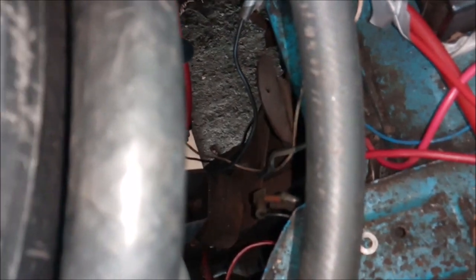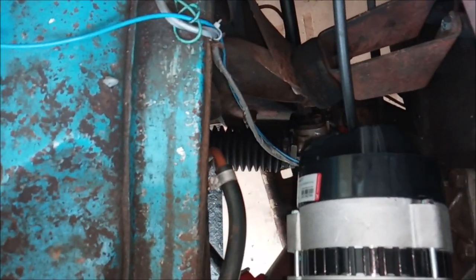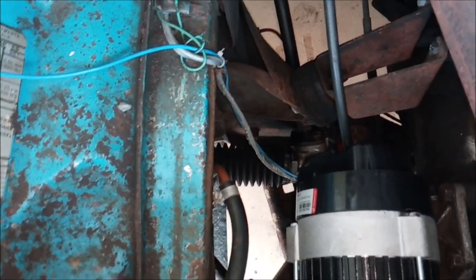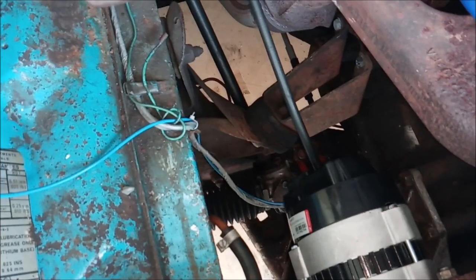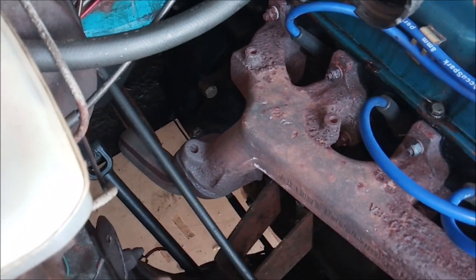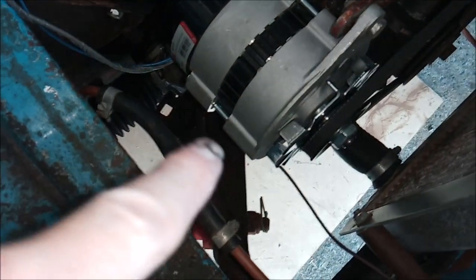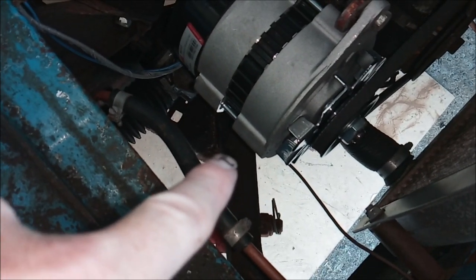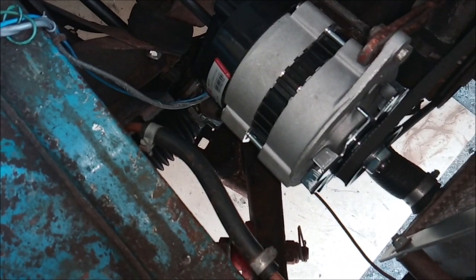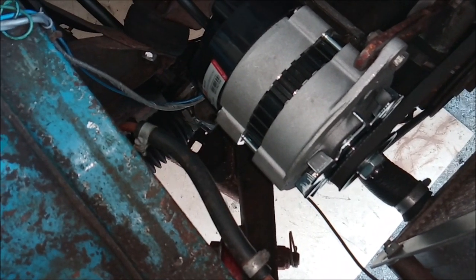So what I'm going to do is unbolt these. What I'll do is I will film unbolting that one, unbolt the other one separately, then I'll jack up the engine from the mount between where it bolts to the gearbox. Because to me, that's kind of like the only place I really can jack it. The manual says you can jack it from the inside of the sump, but I really don't trust that because you could easily push the sump in. So I don't want to do that either.